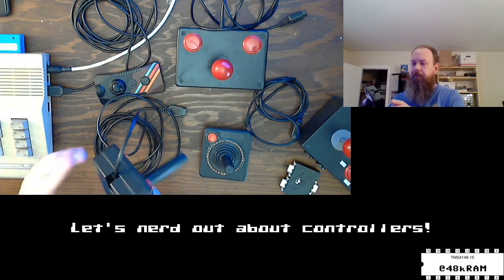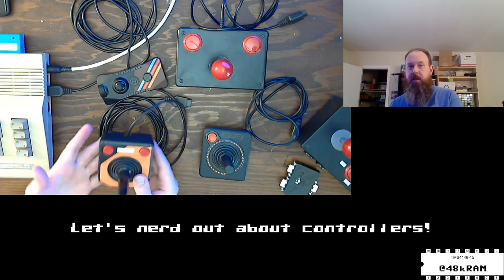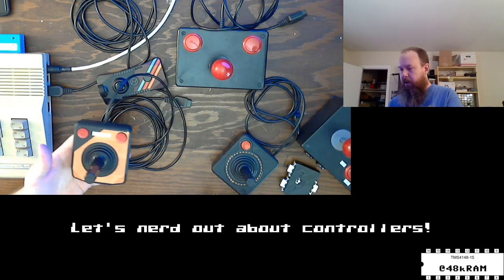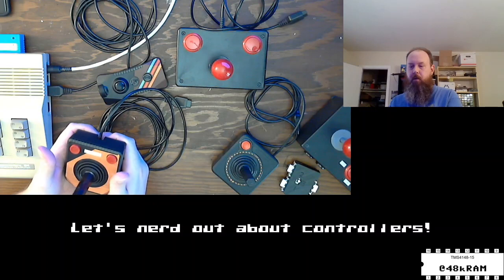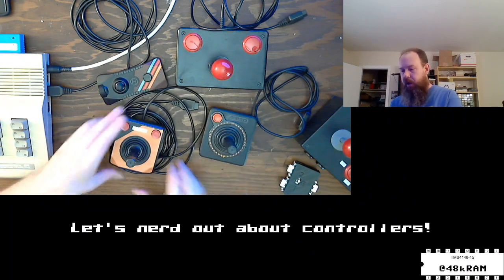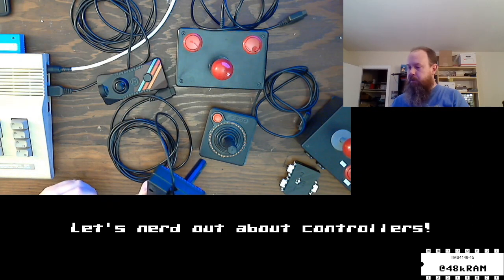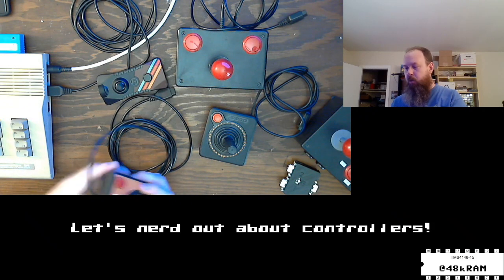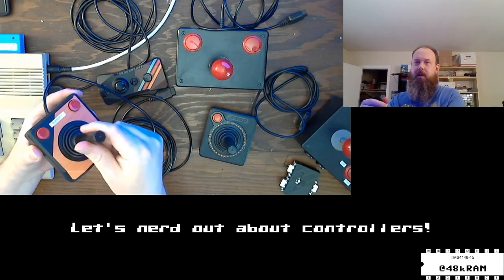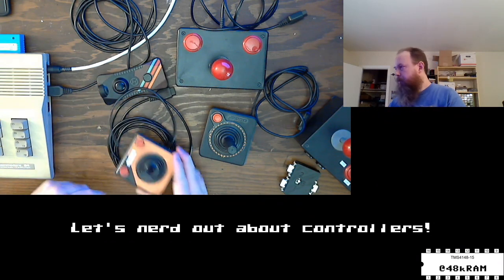The Hyperkin Trooper also works on real systems — Ataris, Commodores, basically everything that takes an Atari-style nine-pin joystick. A couple of nice things about it: it's weighted, so it's fairly hefty — considerably heavier than my original CX40. It has dual fire buttons wired in parallel, making it ambidextrous, which the original CX40 didn't have. And it's got a really long cord, about 10 feet, which is great. One warning though: the stick screws into the base on a plastic thread and if it comes even slightly loose it creates a stress point and snaps right off at the base.